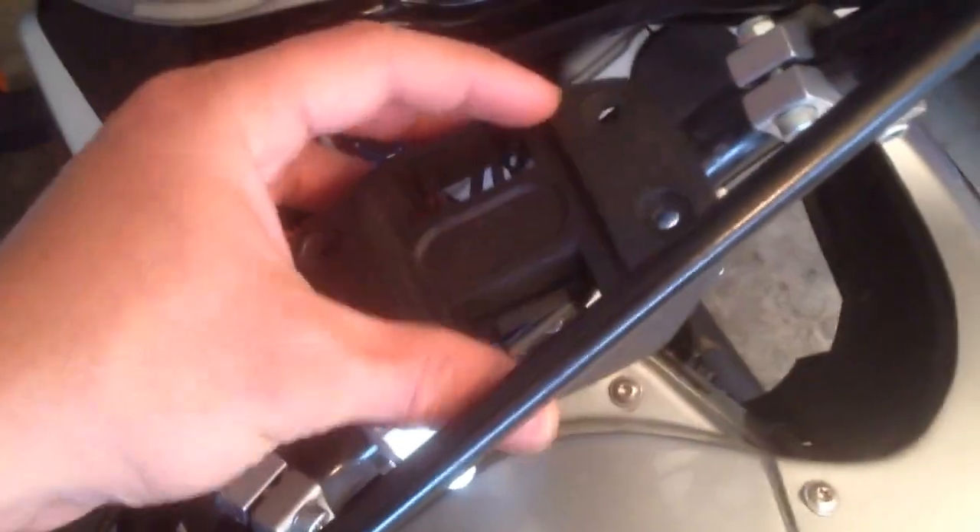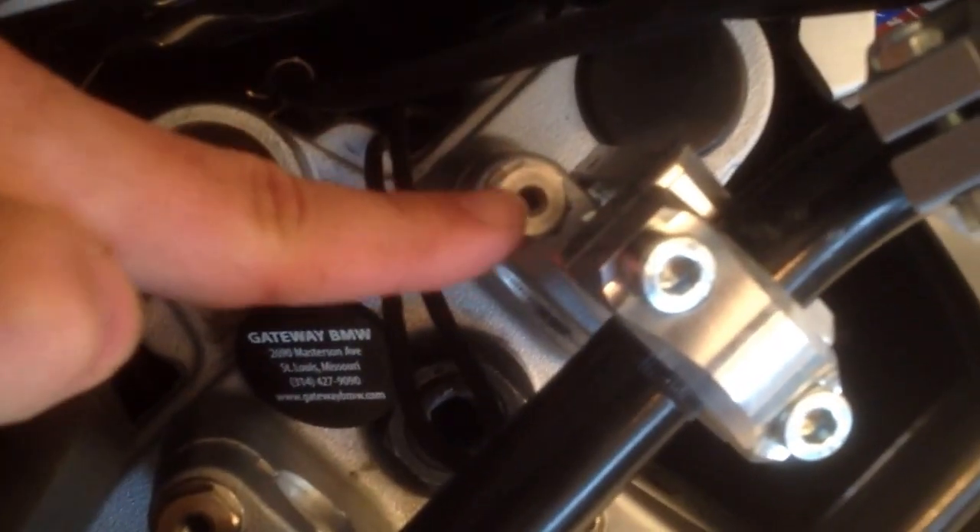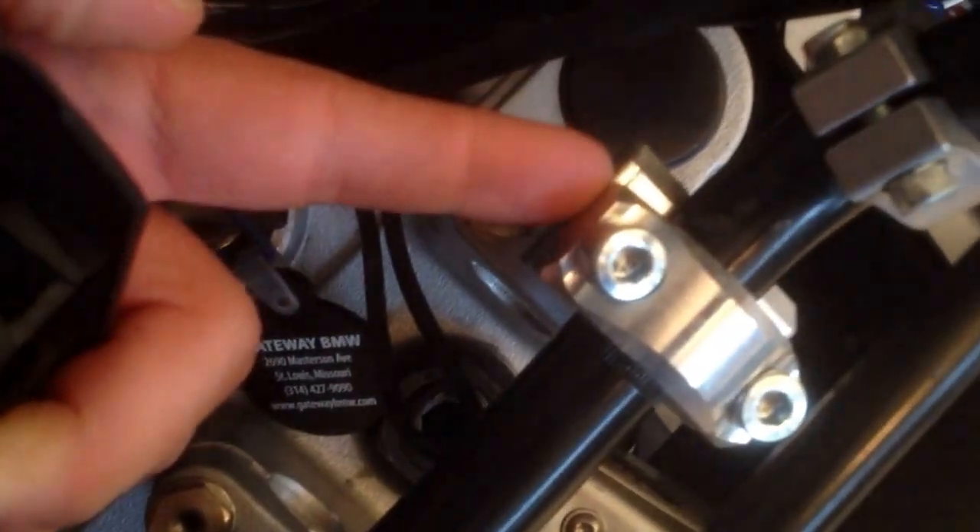Did I show this? It's a 2009 G650 BMW GS. If you have one that has ABS and or hazards, you'll be familiar with that little bracket they had over the handlebars. Those original studs there. The problem is having that in there prevents the use of most risers other than the little block risers, and that certainly prevents you from using Rox risers, such as these.